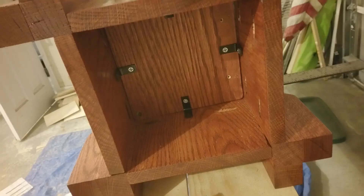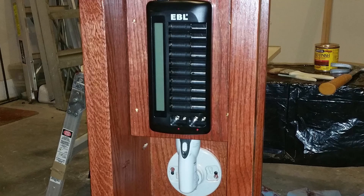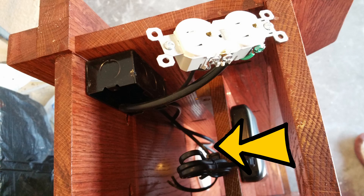The bottom is held in place by four brackets and the empty space is used to hide the power cord. The emergency light is mounted to the rear panel of the cabinet. The battery charger is bolted to a panel mounted to the front of the cabinet, making it easier to reach and also creating a tunnel for the emergency light to shine through. At the top of the cabinet is a double receptacle used by the battery charger and the power supply for dome electronics. You can easily see the emergency light tunnel on the left of the cabinet.